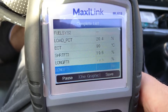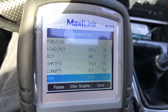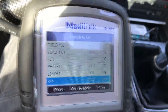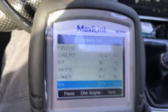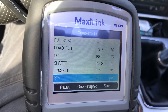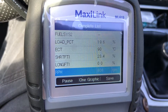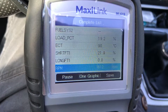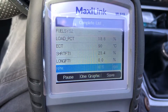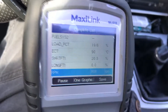This is my short range — so my short range is at 18, which is high. I'm just going to pump the brake pedal and see what happens. Just one press down and it goes up a little bit. I'll press it a lot. And that's what I find: when I press the brake pedal a lot I'm able to get the short term to go up, as in going lean — so it wants to add fuel. I just hold it here and it starts to go down. Then I release the brake pedal. It went back up a little tiny bit, now it's sorting itself out again. I'll have to check that too — I might have a brake booster issue or seal issue in there somewhere.